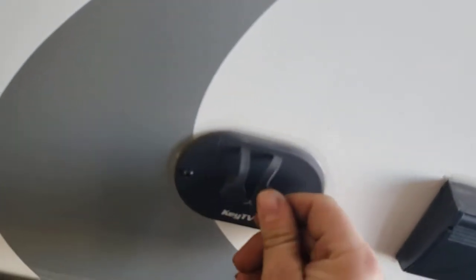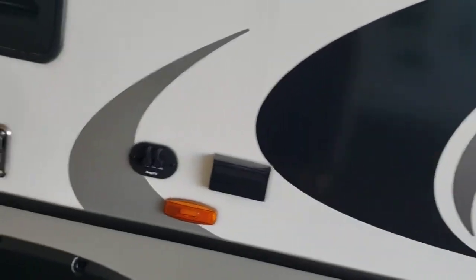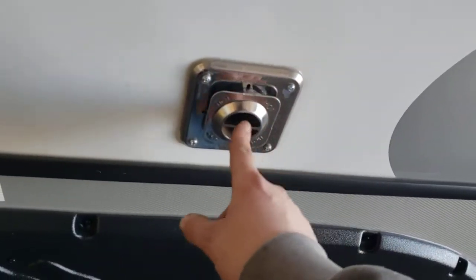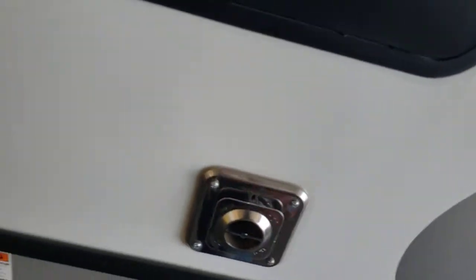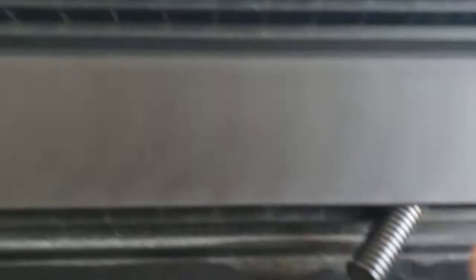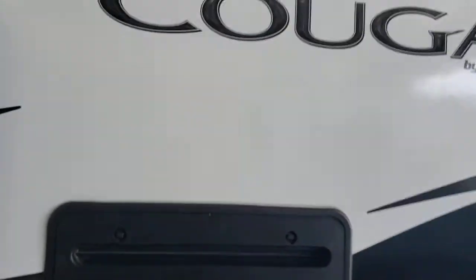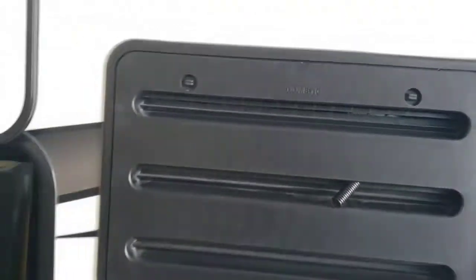You have satellite and cable outlets outside, so if you have a TV on a table out there you can watch TV outside. There's an exhaust for your furnace — keep it clean; they make screens for these but don't recommend running the furnace with the screen on. There's also a fridge vent — keep it clean in there, and there's an exhaust on the roof to keep clean for airflow. I definitely recommend popping this whole thing open and cleaning it out a couple times a year.